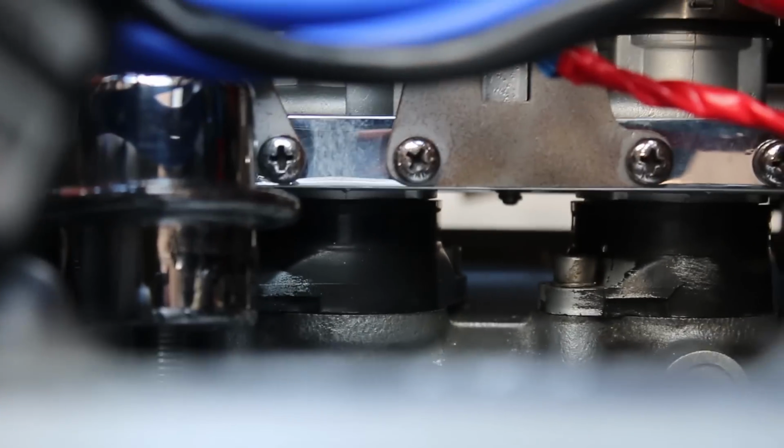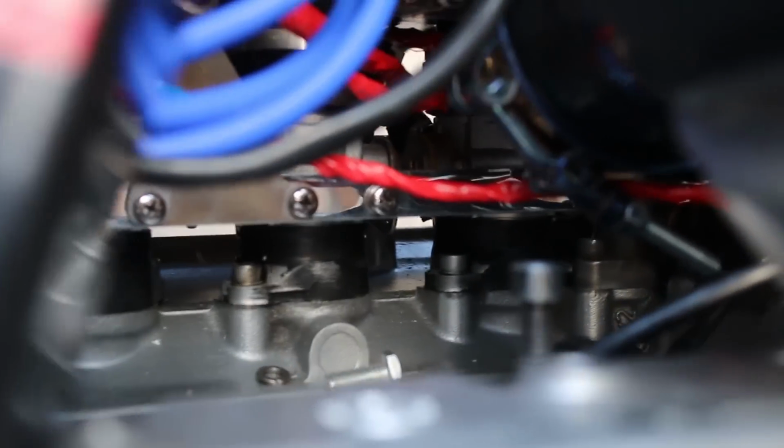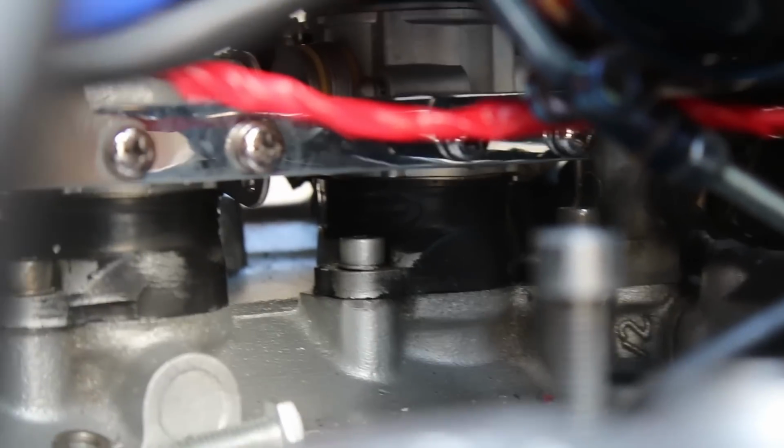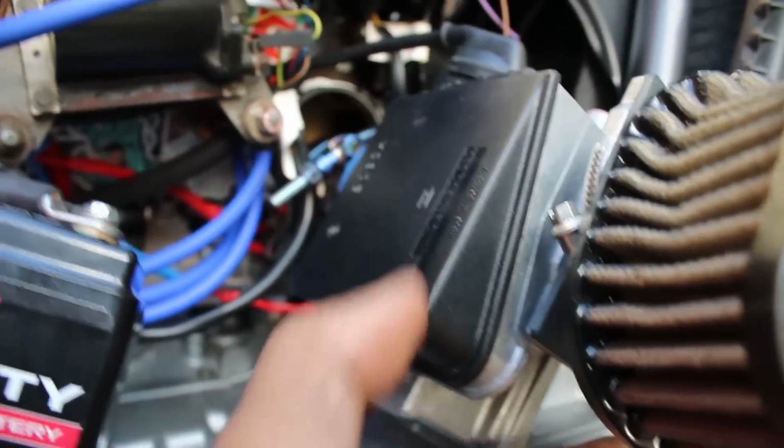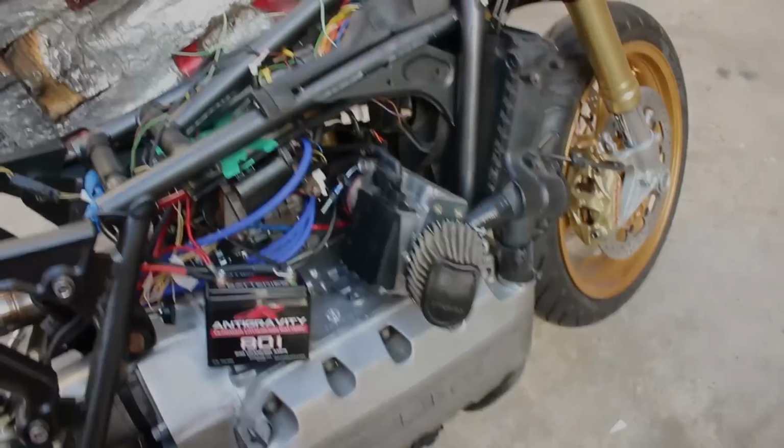The air intake to the airflow sensor also wasn't clamped down, nor was the vacuum hose for the crankcase. But surely this wouldn't stop the bike from firing up, would it? I mean, I know it would just run like dog shit, but it would still fire up, right? Well, fixing those issues would only help my chances, so I better get to it. Fuel, spark, air. Fuel, spark, air.